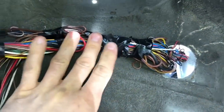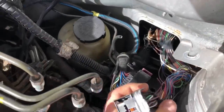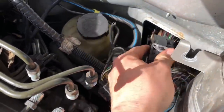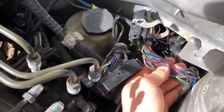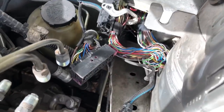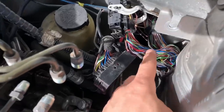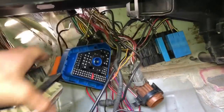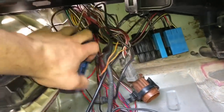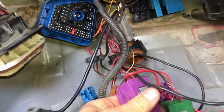It's going to be strapped right in tight to the wing up here. The main logistical thing is this ECU connector - it goes on one side of the ECU and I want that inside the car, which is fine. But as you can see we've only got about eight inches to play with on the wiring, so that's all going to have to be extended.